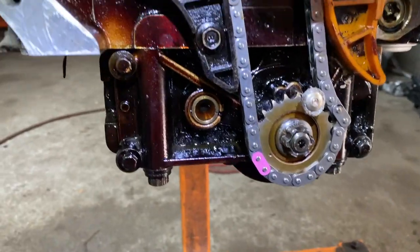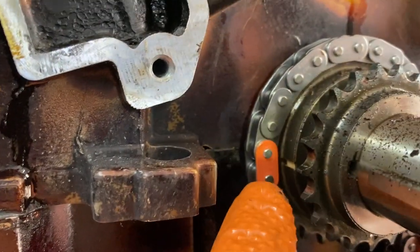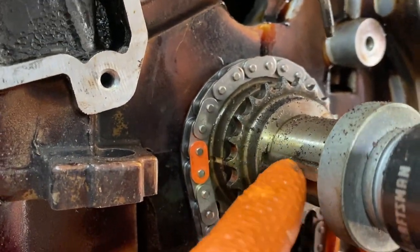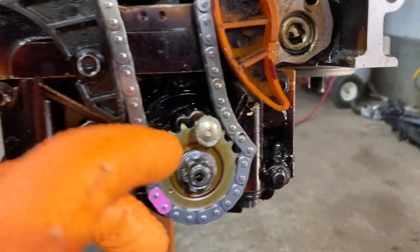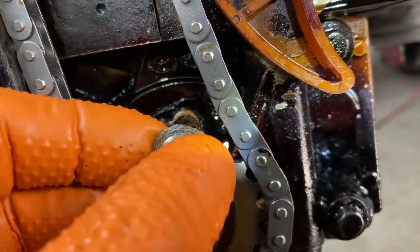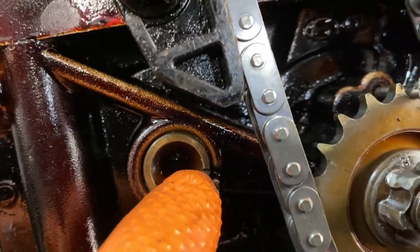So now we have the color mark on the bottom — they're usually orange — marks with the indent over there. See the little mark here — and the crankshaft is still at top dead center. The keyway is vertical, in line with the main bearing cap, you see the seam. And that's how it's got to be done. Like, I just stuck this in anyway but you see it lines up. You just stick it on your tool — as long as it's nice and in there like that, that's it.